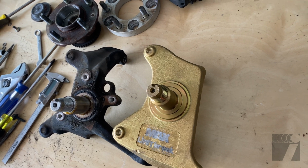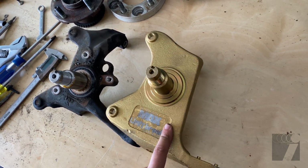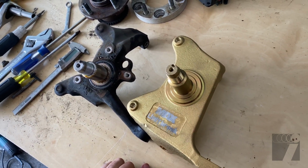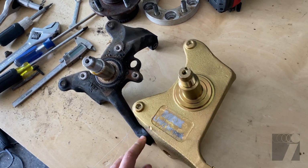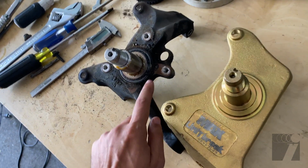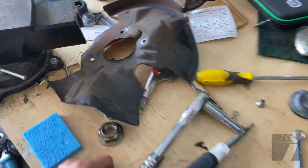And in my case, when the suspension is not going to be compressed, it's going to clear the strut on the coilover. So these are a little bit pricey. I think like $500, $600, but if they work out, then it is what it is. I'm gonna start putting the bearing and hub on here. We also have to do the caliper. I noticed that the ABS sensor, it looks like there's no hole. I think it goes right here, so there's no hole for that, nor is there any holes for the brake dust shield, which I kind of don't want anyway. It's a piece of shit.